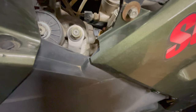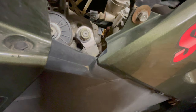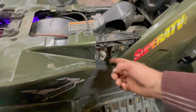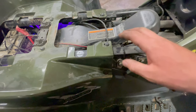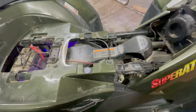As you can see, the bolt's not moving, so the grooves in the aluminum are stripped. It's because it wants to lurch forward, so I think they're having a tough time getting in gear. We're going to need a new one of these arms for sure, but we might have other serious issues. I'm going to go ahead and start pulling everything apart. The first thing is to remove the clutch cover and see what's going on there.